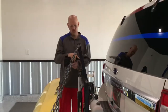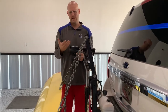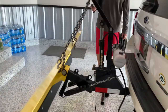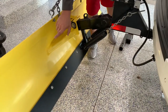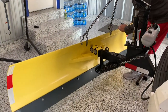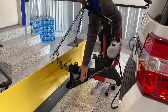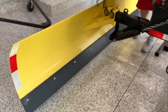You may need a drop hitch for your vehicle. This is just a simple two-inch drop hitch — it drops it down just a couple of inches if your vehicle is a little bit higher. It allows the angle of the blade to hit the ground right so you get maximum scraping efficiency. These springs allow impact to hit the plow on either side. There's no left and right powered function on this plow; it does allow a swing left and right based on what pressure is on the plow. These heavy-duty springs take those hits — if you hit a curb or something like that, it's not going to tear your plow up too badly.